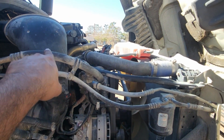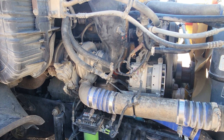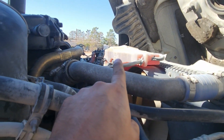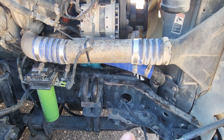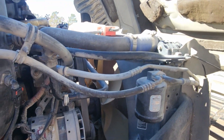Good morning — or actually afternoon, because I just got home. This is Gabe coming back at you again with another video here at Truckin' Life. Our goal for today is on these older systems, on these trucks — my particular case is a Detroit Series 60 — there's no coolant filter anywhere along the truck. So I'm going to show you guys how to install an optional coolant filter to get any impurities out of the system.